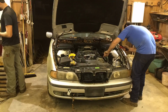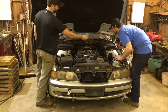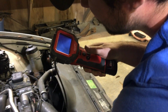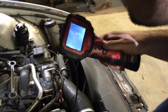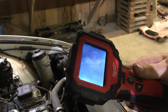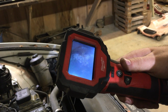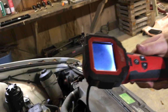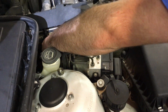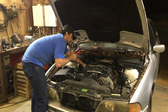To start diagnosing the car, we first remove the spark plugs, then use a borescope camera to look into the cylinders through the spark plug holes. I see valve reliefs. But I'm sure it's supposed to have that. All right, next. Looks to be fine. There we go. You can look closely, you can see valve reliefs. See the white on the valve relief? On the top corner one? I think it kissed it. That next one's the one I'm worried about. That's the one that had aluminum on the spark plug. I can't see what I'm doing. Oh, Lord. The piston looks terrible, but it's too far up to see. I haven't seen the hole yet.